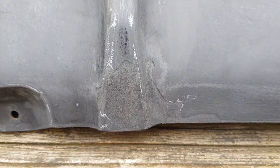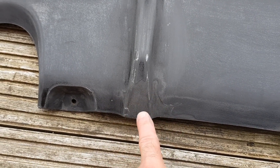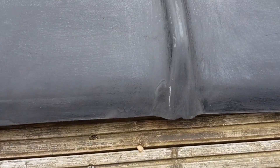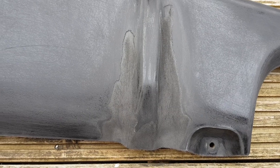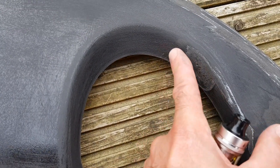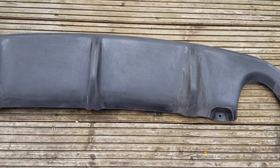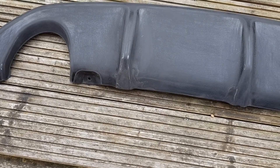Gone with a couple of different grades of sandpaper - this doesn't come out too bad. It's a little bit raised but we'll just give this a blast with a couple of coats of primer before we do the main body of the whole rear splitter. We'll concentrate on these areas first just to see if we can blend them in a little bit better. Got a little bit burnt from the exhaust tips but that's the best we're going to get it. Hit that with a couple of different grades of sandpaper and now we're going to give it a wash down, clean it, and then start prepping on the primer.